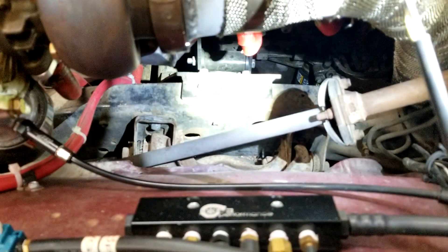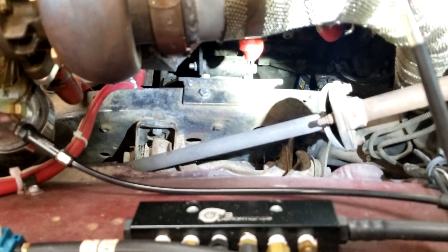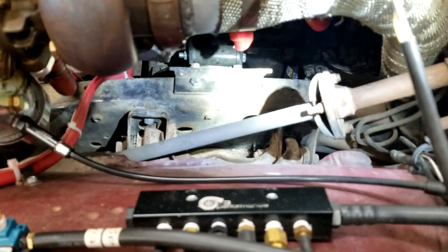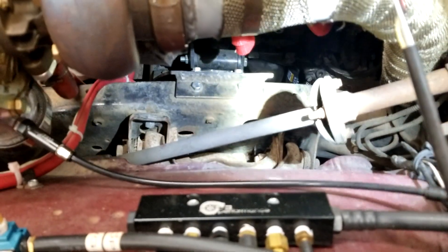You stick your plate steel in there on both sides, get the motor to the height you want, and then just mark that. You cut off some short pieces — this looks like about two-inch by maybe five and a half. You can just tack them on there, set everything in, tack it, pull it back out, and weld the pieces together. Easy if the motor is out — I got another video on it somewhere.